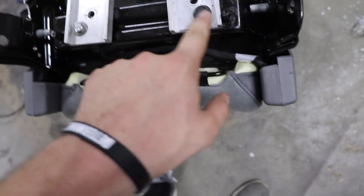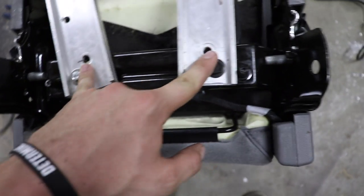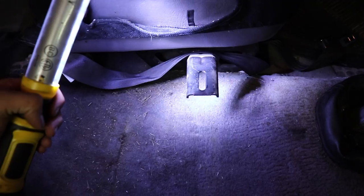We've got some progress. Here's what we're gonna do — we've got these two bolts right here. I drilled some holes through these flat brackets right here. I got these L-shaped cuts notched out of the brackets without damaging the buckle assembly on each side — about a 90-degree cut. These holes were already here before I messed with it today, but I drilled a hole here and here, and then straight above it measured out there and there. Then I drilled out right here a little offset favoring the inside. If you come into the truck, I'll show you exactly where I'm gonna run these bolts through. For the front, I'm gonna run the bolts through there with a washer and a lock nut, and a washer and a lock nut there. For the back, those second holes are actually gonna run through right here and tighten up on there on both sides. I've got the hardware for all that stuff — some pretty basic stuff, but it's gonna sit in there very, very nice.